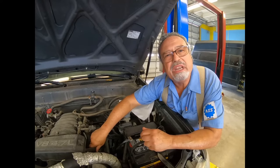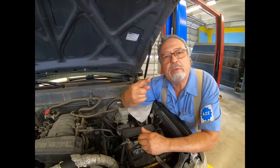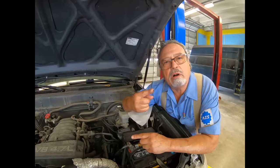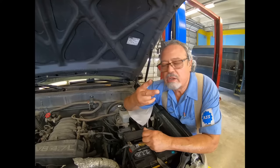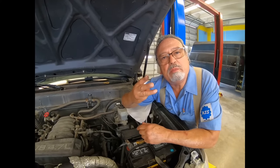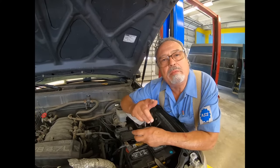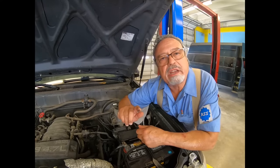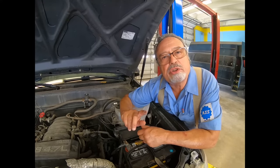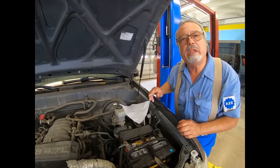The PCV system is good for three things. First: save the world — reducing emissions, and this world needs saving. The paper needs to stick; if your paper doesn't stick, there's something wrong. Second: it's the main control valve that helps keep your engine oil clean. Third most important thing: it helps to prevent oil leaks. If the paper doesn't stick, that means you have positive crankcase pressure — you don't want that. If you have positive crankcase pressure, you're going to blow your oil seals and your gaskets are going to start leaking.